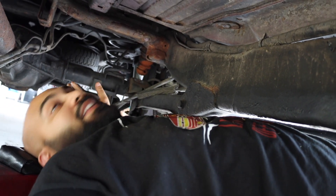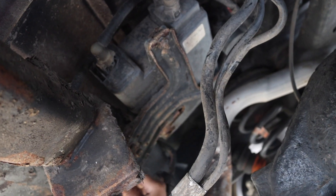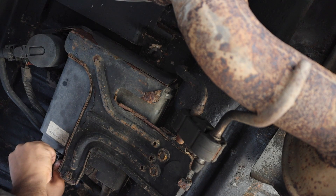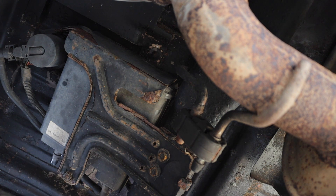Let's see what's needed for this vapor canister. The vapor canister is this black box right here — not sure how well you guys can see this, but this is it. All we have to do is disconnect these lines around the vapor canister and then take off about four fasteners — two nuts and two bolts — and it should drop down so we can replace the canister. Ow, there's so much dust under here. All those lines just came out.